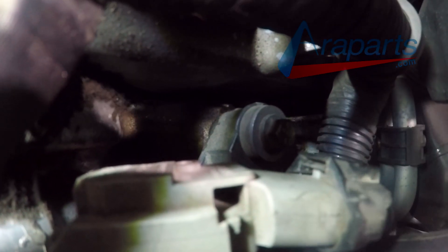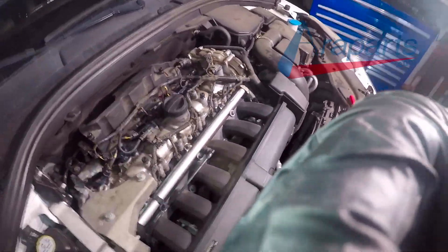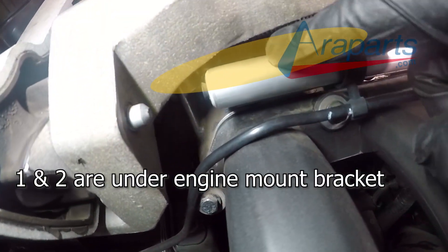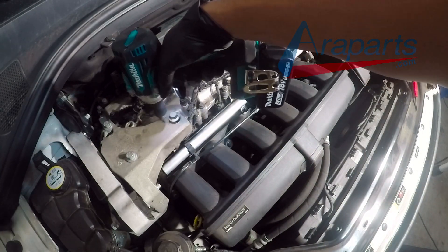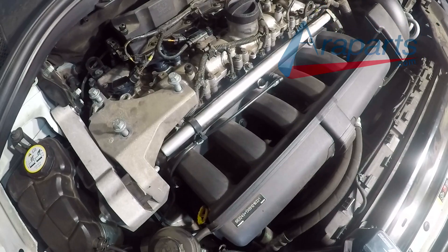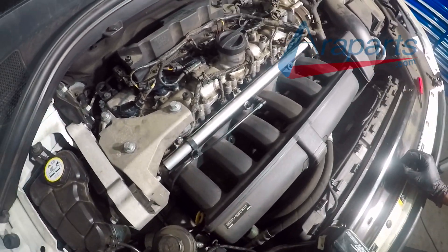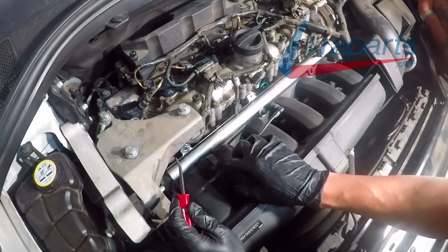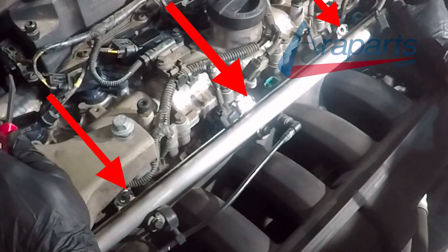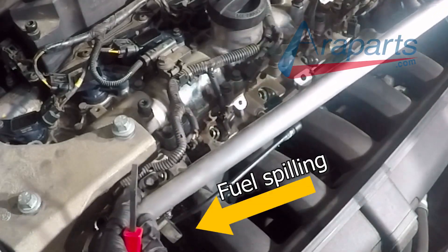I'll be showing you exactly what I'm doing. This plug connecting to the fuel rail is going to be removed. As you can see, cylinder number 1 and 2 injectors are in a very tight spot — I can't even unplug them without loosening up the engine mount and dropping the engine just a little bit. I'm not even taking the bolts off, just loosening them with my jack underneath to support the engine. The fuel rail comes off very easily — there are only three bolts holding it on plus a little plastic clip. Once you have everything loose, wiggle it out carefully so you don't damage the O-rings.